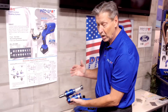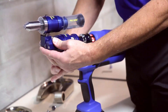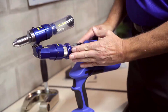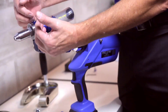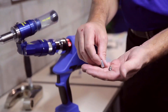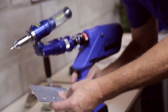It's designed to not require an oil source from the outside — everything is enclosed. We simply put it on to the self-piercing gun and now we can pivot in all kinds of different angles. The way it works is that we are pushing onto the cylinder inside, where the oil comes up to the upper adapter that has a different cylinder and piston. The force of the oil is pushing that cylinder in a rearward motion, making it able for us to pull instead of push. We can also perform rivet nuts as well as all kinds of different sizes of blind rivets. The blind rivet simply comes in the front here — we have the calibrated hole that is needed — and I simply put this in.